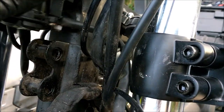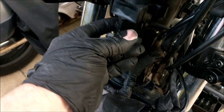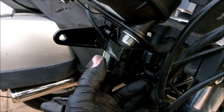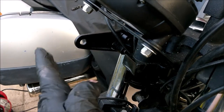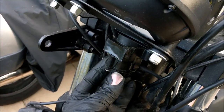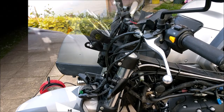Completely, perfectly good. Why have you done that, EZ? Well, it's obviously two reasons. One, so the key doesn't foul it. And two, because when that's there, this is technically further forward, isn't it? Slide that up, goes back in, and out there, it fouls the headlight. So just doing that little mod there makes it easier for me to fit the headlight. Right. Okay, time for a brew.